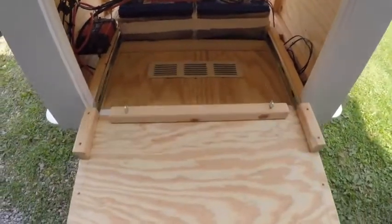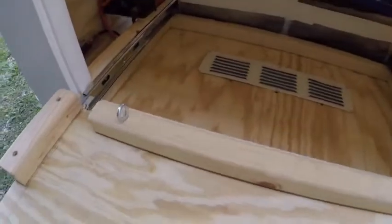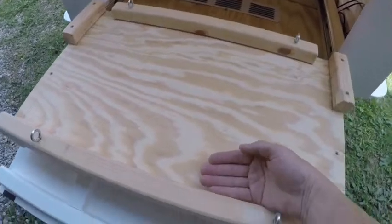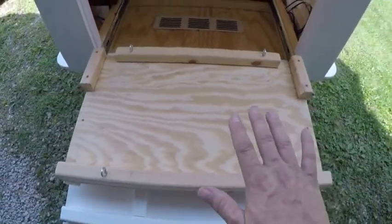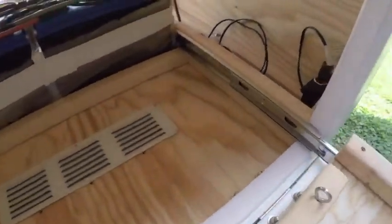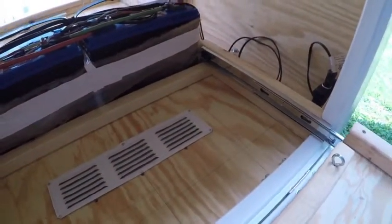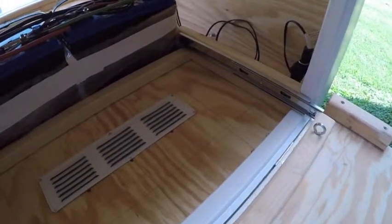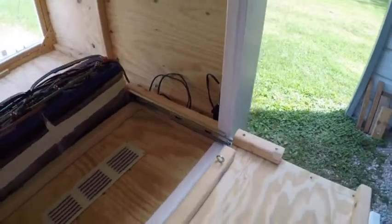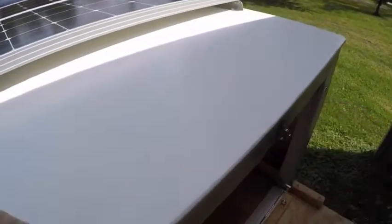There's a sliding rack for the refrigerator. I've got four eyelets on the mount on the slider shelf so I can take bungees or paracord and strap the cooler down to the platform so it doesn't bounce out of the pocket I made for it on bumpy roads. I decided not to put a vent in the top with cooling fans — I think the trailer is big enough it won't be an issue, and I want as few holes in the roof as possible to avoid water getting inside.